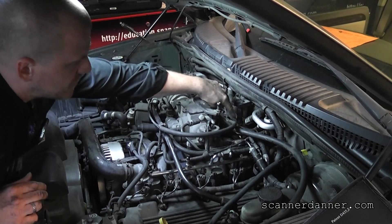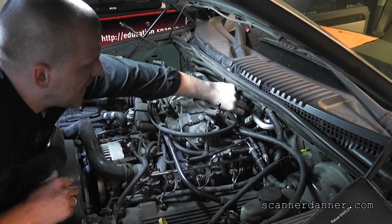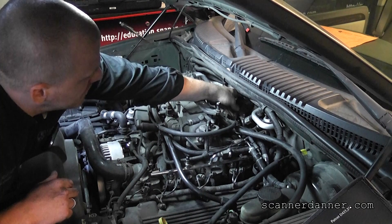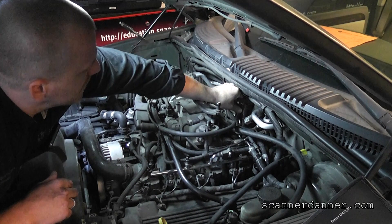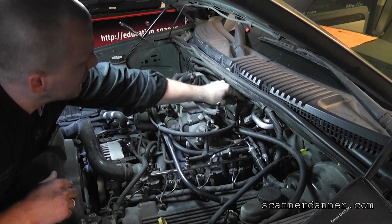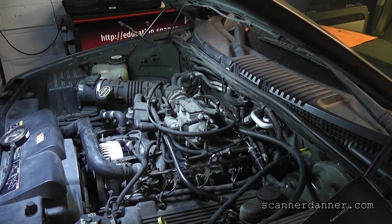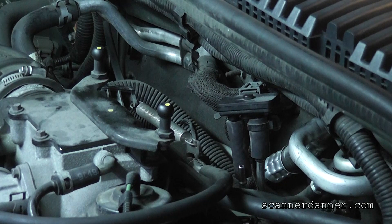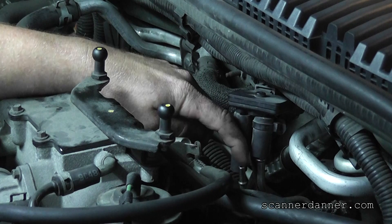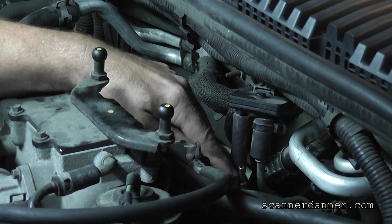What we want to do with this is just take one of these two hoses off — it doesn't matter which one. I'll pop them both off and then plug one back on. I just need to have an open port. These are exhaust tubes. All I did was pop the hose off here, and there is a metal port that goes down to the exhaust pipe. We can do a measurement right there.